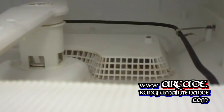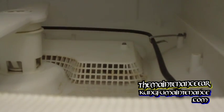If your dishes are coming out dirty, make sure you've added a rinse agent and you're using the correct kind of soap. You want to run your hot water first, check the air gap to make sure that's clear, and also check the disposal drain line. Then you want to check inside the sump.